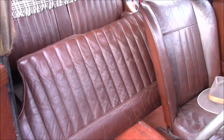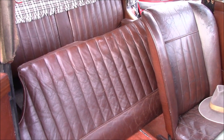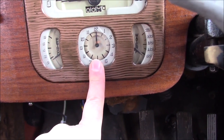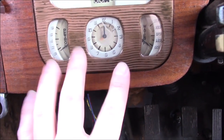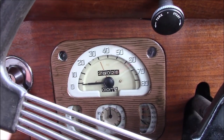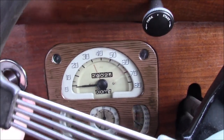I've got enough things connected up — I just want to see what happens when I connect the battery, make sure there are no weird noises or anything. The battery in the car is pretty flat. I have wired up the clock the way the diagram shows — I can't hear it running, but I don't know if that's because I've wired it wrong or because the clock itself doesn't work. I'll have to do some further testing on that. The battery is quite flat, so I don't think there's enough power in it to actually fire the starter motor — I'm not going to try that. I just want to see if we get anything come on on the dash.